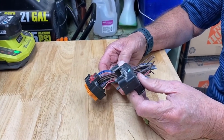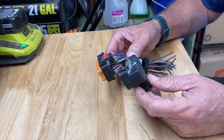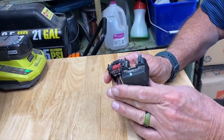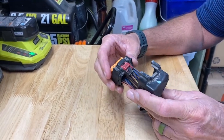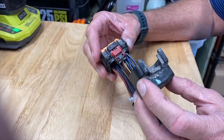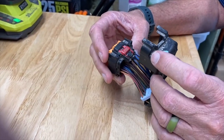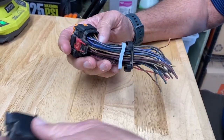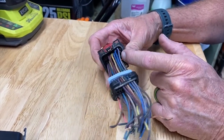This is the used connector I got from a junkyard. You can see it was a little melted and brittle from being out in the sun. The first thing you have to do is remove the cover from the back — it has four little tabs that fit through here. In trying to remove those, three of them broke; they're very brittle. Even on my Jeep, being very careful, I still broke a couple. You pry them out of the little slots, remove the cover, and behind it is this piece and a gasket.